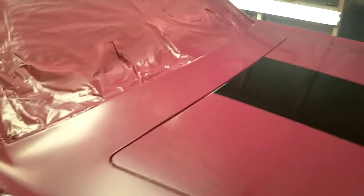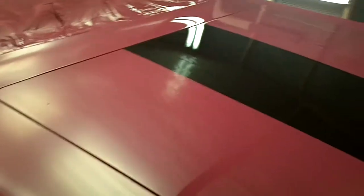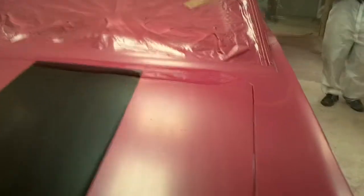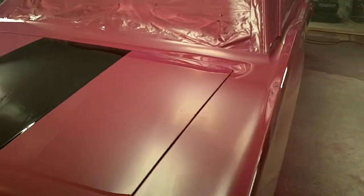We're going to have to do some wet sanding — do some color sanding on this thing. Won't be surprised if there's not a spot or two we have to touch up on the clear coat. Mike has forbidden me from using the buffer, so we're going to have to hand sand it.